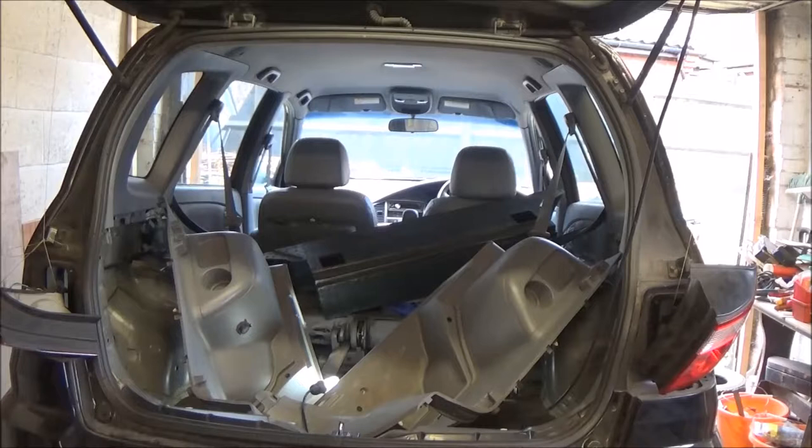There are also two under each of the light clusters, so you have to take those off — another four nuts. There's nothing hard about this job; it's purely the fact that to mount what is maybe ten to twelve studs maximum holding the tow hitch and bracket onto the chassis members, there are hundreds of these horrible little plastic fastener things involved, and you've got to strip out half the back end of the car. I really can't see it being a cheap job even for a specialist, and having to take the road wheels off to get to some screws is just unbelievable.